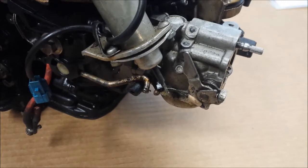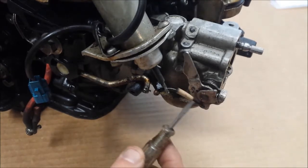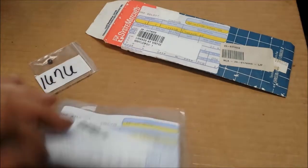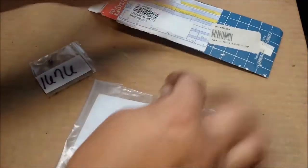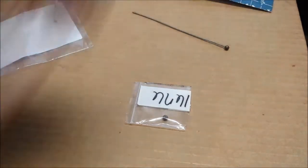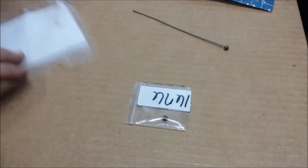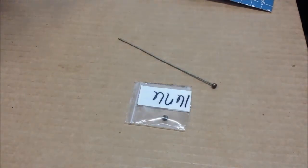Let me show you the cable system. Here's a cable system type off my other spare powerhead. It consists of three parts: the cable, a little cable liner, and the end ball that you crimp on to make it work. The issue is if you needed to get the carburetor off or the choke solenoid, you're cutting this cable and cutting this ball off. The cable is still saveable so you'd only be replacing those two parts - that's why I didn't like this idea.